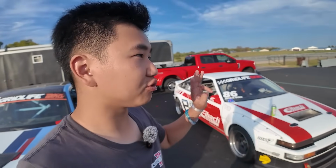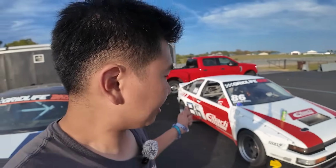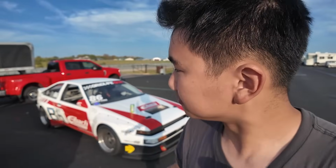Three, I'm going to go for a cambered axle setup. That's coming soon. I want to be able to add some alignment in the back so it's not just zero camber all the way around in the back and slide for days. If I can trust the rear axle and lean on it even harder. This weekend was already pretty awesome, but if I have even more rear grip, that would be great, because then I can make the front dive into corners even better.